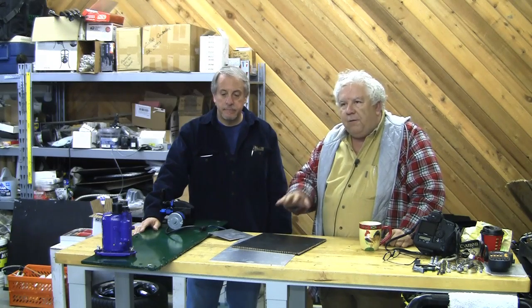We are building this plate. I'm a little weight conscious these days. We've put a whole lot of batteries in there and we're going to be heavy. Basically, with this battery pack in this car, I would guess a mile of range per 40 to 50 pounds. So that's why we kind of carefully trimmed the adapter plate and lost 35 pounds.